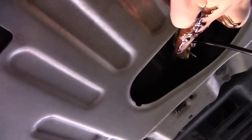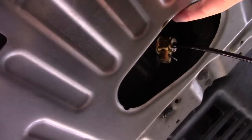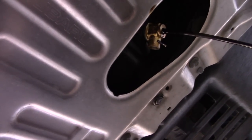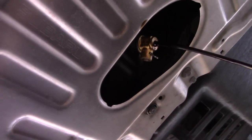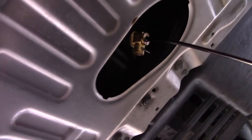I for some reason thought it came out of here. Now my only concern really with the Fumoto valve is if the threads are pushed in to the oil pan, then hypothetically speaking, it's not draining all the oil. And then you're kind of just circulating old oil constantly in the motor, which I don't really like that idea. So I think what I'm going to do is, once this drains out, put it in containers and see how much is actually there, and then I can measure if there's anything left in the oil pan still.